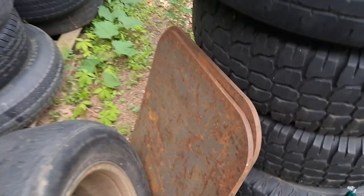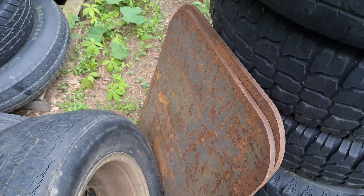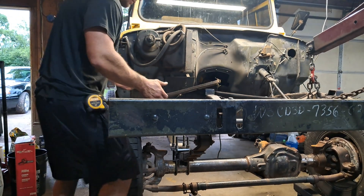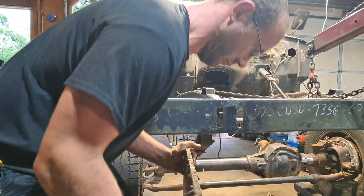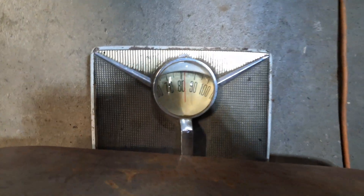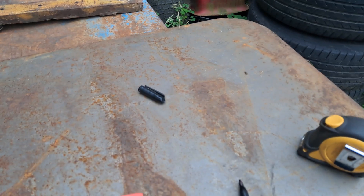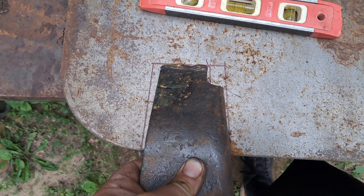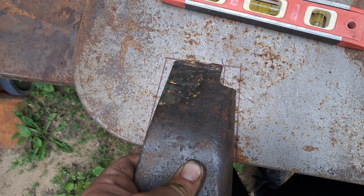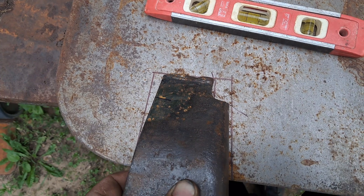Alright, this is what I got here. I have some sheets of mild steel here that are half-inch thick and weigh a ton. I want to see what one of these weighs. So this sheet of steel weighs about 82 pounds — it's heavy. Instead of just cutting out a four-by-four half-inch square, I just kind of laid this down, traced how it's going to sit on the frame, made some marks from the edge, ran that up, traced the edge there and up and over. So I'm just going to cut that out.